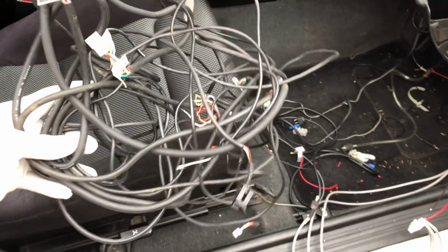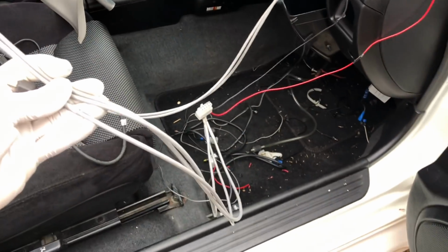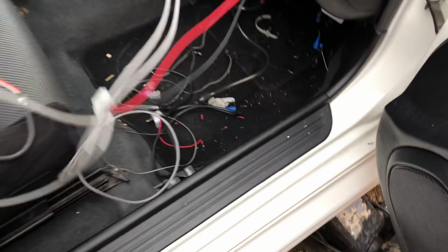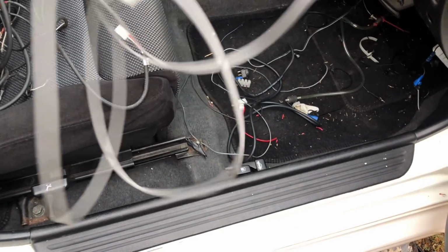This ain't even all of it. This is just what's in my hand right now. So we've literally narrowed it down to one gauge that does 2 functions instead of 2 gauges with loads and loads of wiring everywhere. So these SPA gauges are amazing. Literally only have to wire in an earth and a positive, and just plug it in basically, and you've got this switch here that allows you to go through all the functions, which I'll show you when I've set that up. So I'm just going to put the gauge into this pillar pod now.